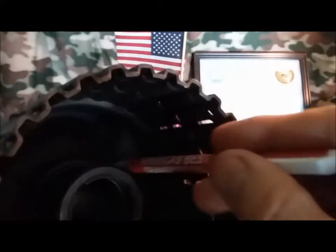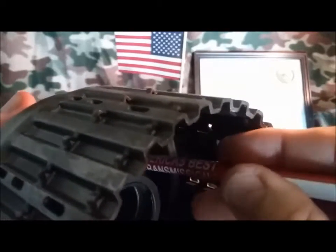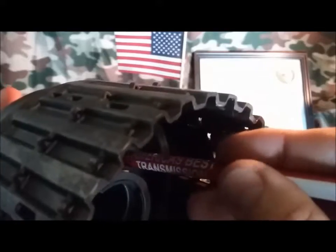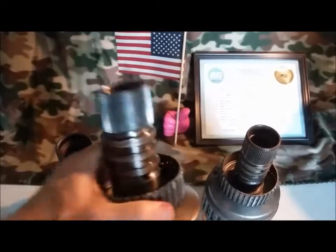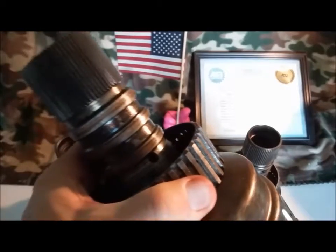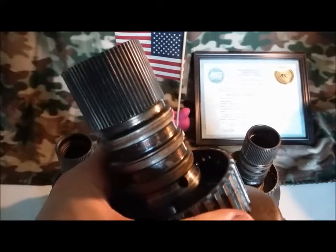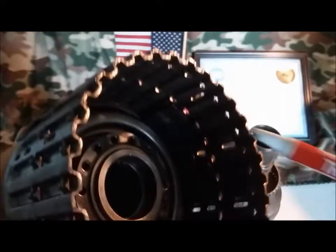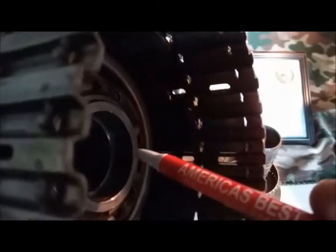Now, you can't get the thick lip seal down into the drum for the thin one, but you can accidentally put the thin one in the drum that takes the thick lip seal, and disaster will occur. The third drum also has no taper here. This drum has some overlap between the 440s and the 4T60Es due to the fact it was manufactured between 1988 and 1993. It is referred to as the bearing type because a bearing goes here instead of a thrust washer, and there is still no inner caged bearing down in here.